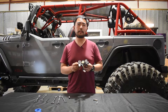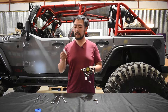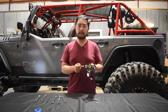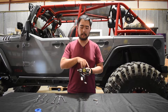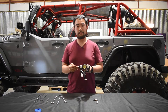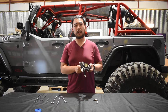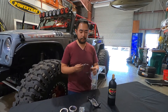There is your manifold kit assembled. All that's left to do is plumb your airlines and run your wiring. When running your airlines, you have the airline coming from your source into the input. Your electronic switches operate the solenoids and send air to either side. Your gauge shows your line pressure and your pressure release valve prevents any pressure spikes from damaging your equipment.